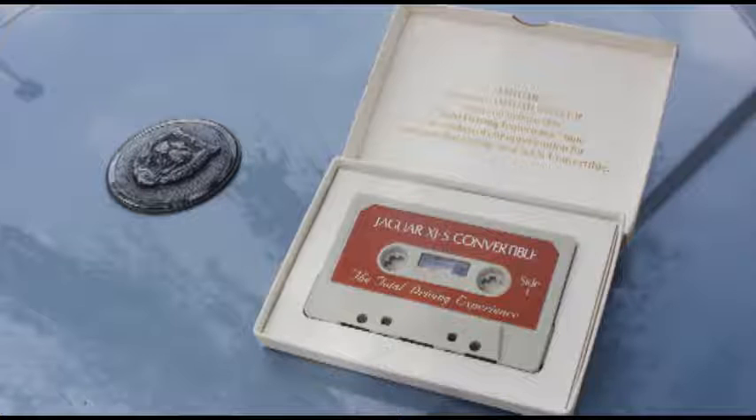There are several important procedures which must be followed before the roof can be lowered. First, be sure there is nothing in the roof storage area which could interfere with lowering the top or damage the heated rear window. Take care that hands, fingers, hair, or other objects are well away from the windows and roof mechanism. The roof switch can only be operated when the car is stationary, the handbrake is on, the gear selector is in park or neutral, and the ignition switch is in position one or two.